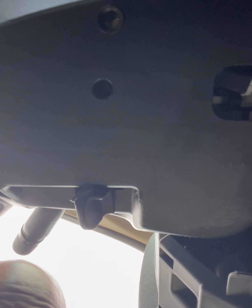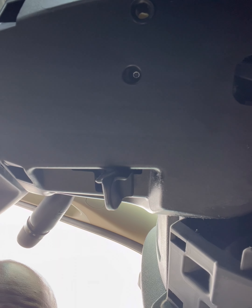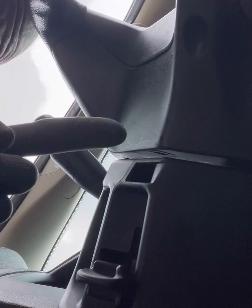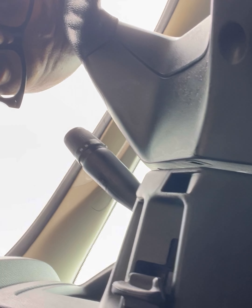The first thing I'm going to do is remove these two Phillips screws — there's one there and one here. Next, I'm going to go right underneath the steering wheel in that middle hole with a T20 and remove that screw. I have another screw in this slot and another screw in that slot, also T20. We got to get those out.